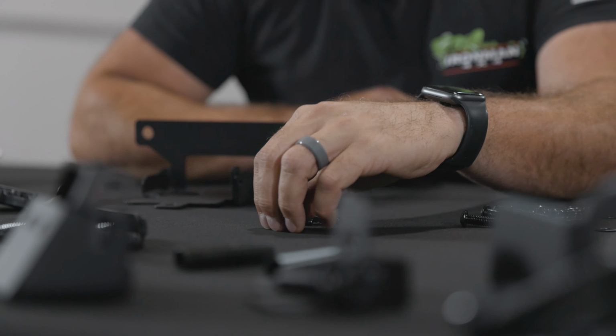All right, now I'm going to show you where we need to make some cuts. So with your grill laying face down, so this would be like on the back side of the truck, I'm just going to take a silver paint pen and we're going to cut away this rib right here. That gets cut. This gets cut. I'll make a little arrow so we know what we're cutting. That gets cut there. And at the bottom, we're basically coming straight down and we're just cutting all that out. So we're just making a big C cut right there, straight down.